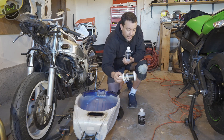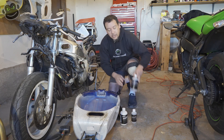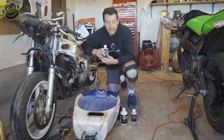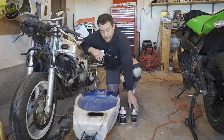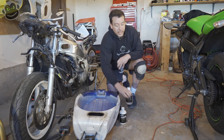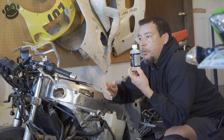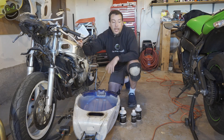There's the liner, which is the last thing we'll use, there's B, and there's A. Just like a regular alphabet, we'll start off with A, which will clean all the rust and etch the metal inside the tank. That etching is necessary so that the Kreem liner will have something to adhere to. This stuff is mostly alcohol, so once you run A through the tank, you rinse, and B will break down all the H2O — it says right here: 'Tank Prep B Conditioner removes H2O' — so it's mostly alcohol which breaks down water molecules.